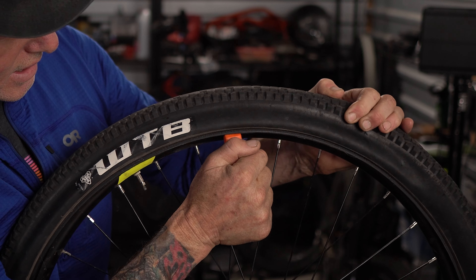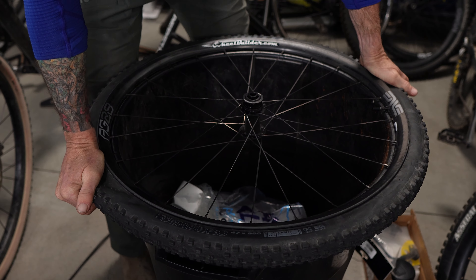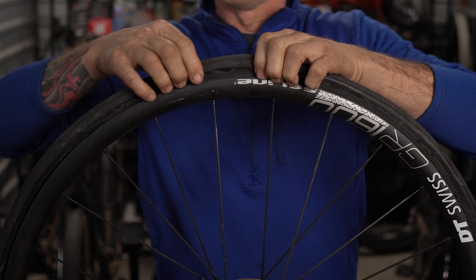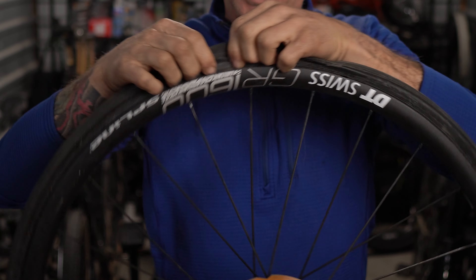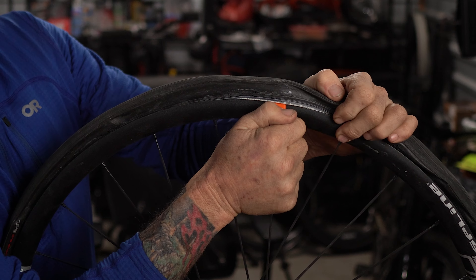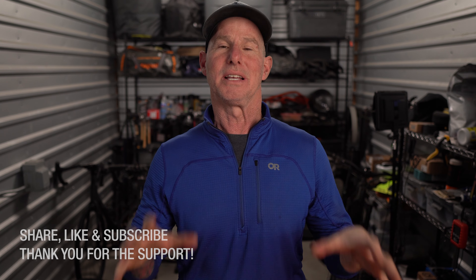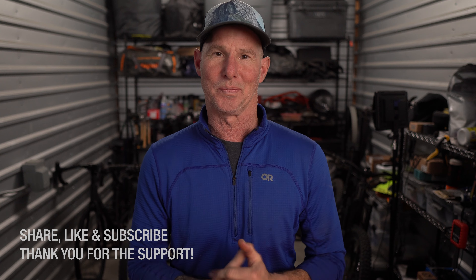So those were three different types of tires and wheels and how to use a tire lever on each one. We had a pretty generic mountain bike tire that was easy to remove with just one tire lever. I had the gravel bike, which we had to throw on the trash can and put some weight on to get that to separate from the rim. And then we just did a road tire tubeless setup with sealant in it — you saw how I used my fingers to pull the tire away from the rim, inserted the tire lever and then spun it around and released the whole tire. If you have any questions or comments, please leave them below in the comment section and I'll get to them within 24 hours. If you got value out of that, please hit like and subscribe — it really helps the channel. Thanks for being a part of the mark list and I'll see you on the next one.